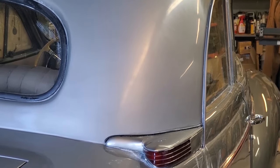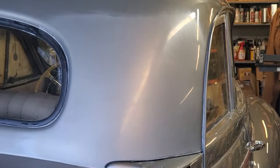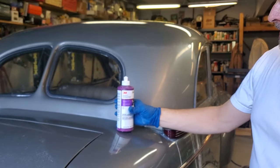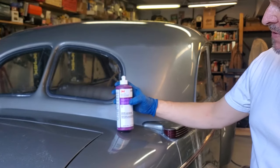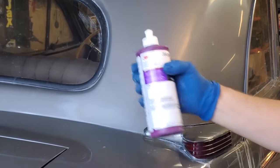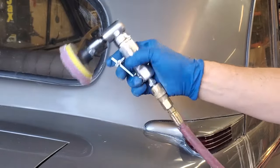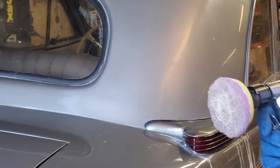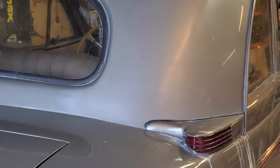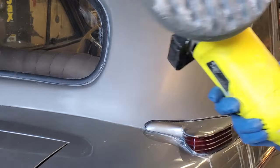In real life, we've probably spent a good half hour on this — so this is not a short time commitment. Next you're going to need 3M Perfect-It Rubbing Compound. It comes in different sizes so I won't give you the number — just look for the name: 3M Perfect-It Rubbing Compound. You're also going to need a small polishing unit — this is an air-powered one. You definitely need something small for tight spots on a car. For larger areas like a roof or door panel you can use a full-size electric polisher.